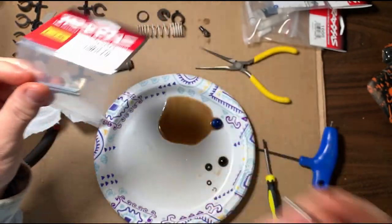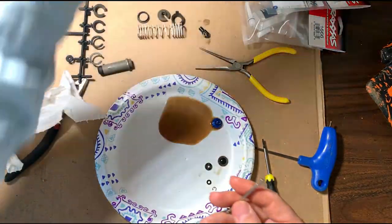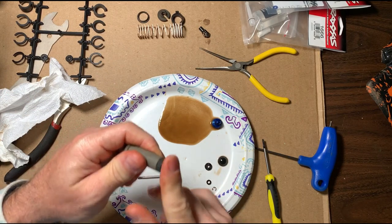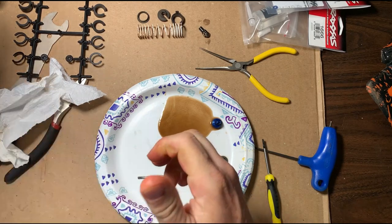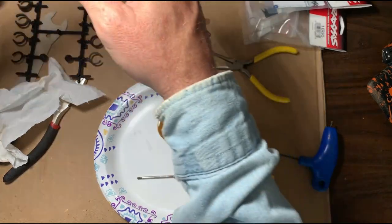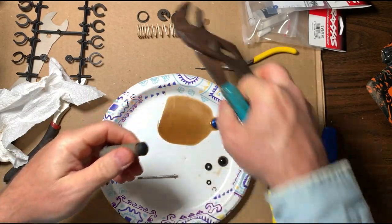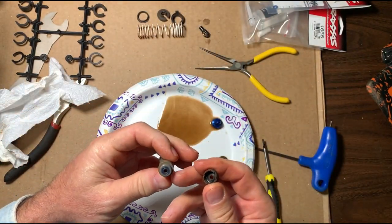It's actually not too bad, so I'm going to go ahead and reuse this shaft. Now we're going to go over to the shock body. You have to unscrew this, and here you should have three or four washers. I can't get it loose with these big old rusty channel locks — get something to grip down on it and unscrew it. It's kind of dirty in there.